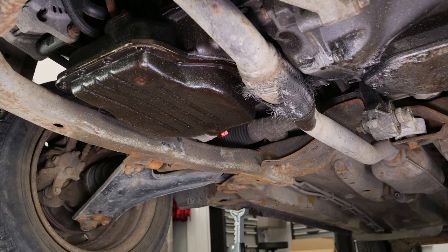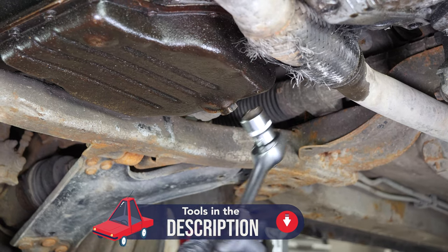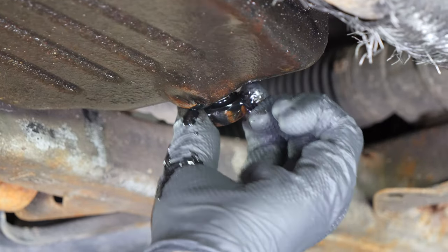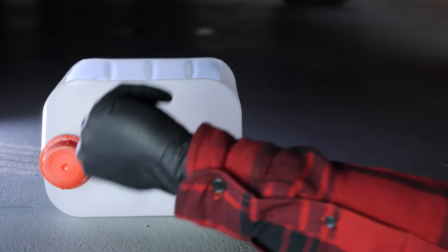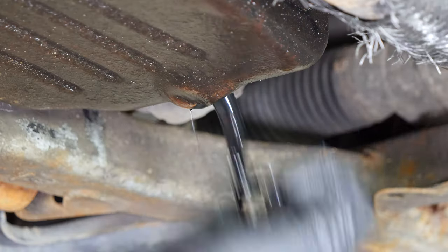You can now see the drain bolt. Using a socket wrench and a 22mm socket, unscrew the drain nut. Start the process with the wrench and finish off by hand. Be careful on the last few turns — the oil can squirt suddenly. Make sure you have an oil recovery can at your disposal; we even suggest crafting one by watching our video on how to make a collector for liquids.